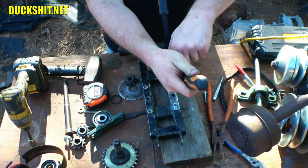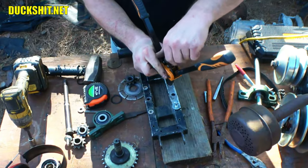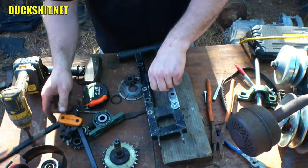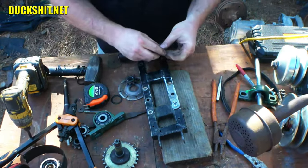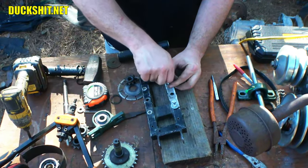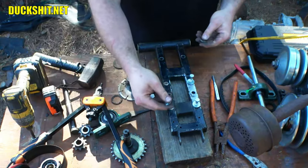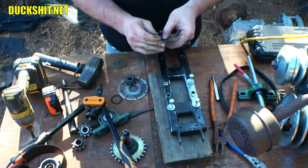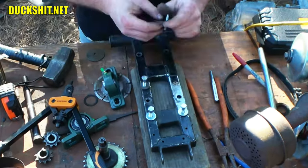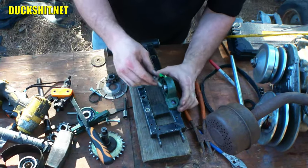That's it. Went tight. And these things, as I said, you do not force them because you will blow the tool out. These tools are, well, they're Chinese made. They're cheap. That's it. Riv nuts tight. No, it actually did snug up, so we're good. These are set up here. Nuts and bolts. All looks good. There they are. All right, these riv nuts, as I said, are awesome.